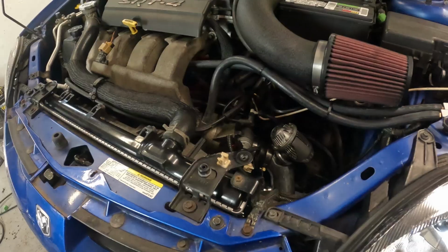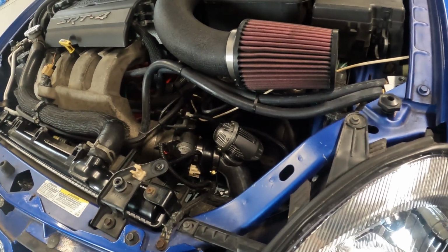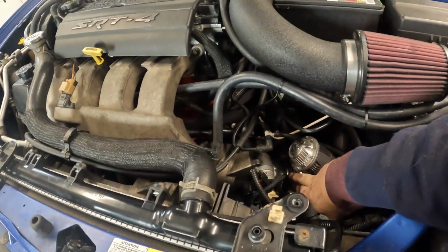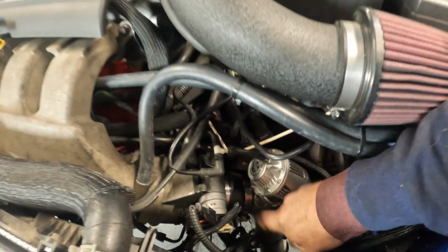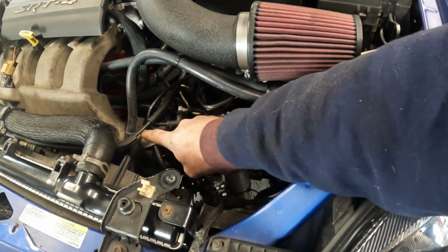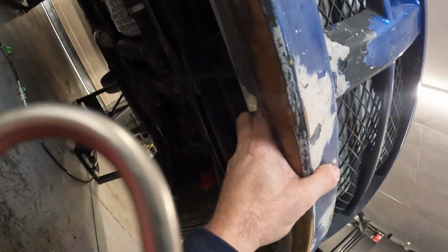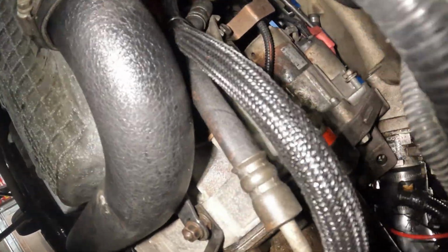Okay, so we have the crank sensor installed. I just figured I'd show you what I did. Basically, I pulled this upper pipe here just by undoing it at this clamp, unplugged this stuff, pulled the throttle body and the spacer off, which allowed me access to the 3 bolts for the starter. Then I was able to access it on the bottom. Because it's right there, you can see the wire coming up off of it. There you go, there it is. And the bolt for that is actually on the top left of the screen there.